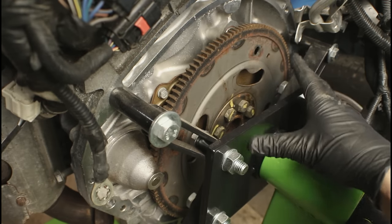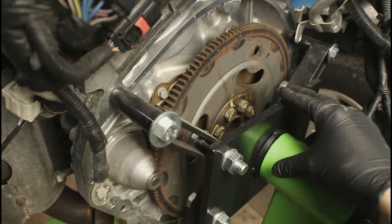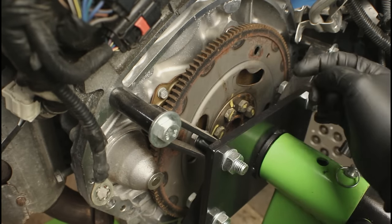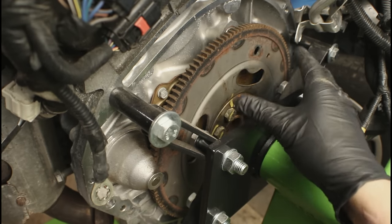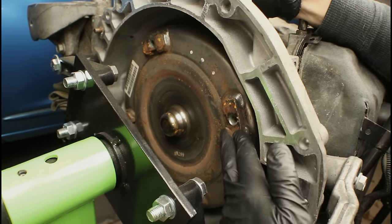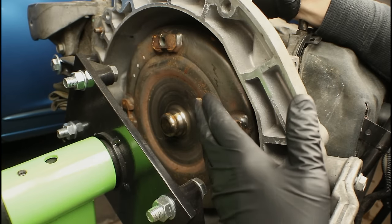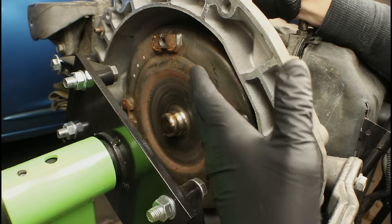When the engine's running, the crankshaft is spinning. The crankshaft is the heart of this engine — it controls piston movement and everything that's chain driven or belt operated. The crankshaft runs the whole length of the block and comes out the front and the rear. That's the rotating item on the block that we need to connect to the transaxle. It's the rotation of the crankshaft that turns the torque converter, which I'm pointing to right here. The torque converter turns the front pump, which controls all the hydraulic pressure inside the transmission, operates all the clutches, and gives you all the gears and your movement both forward and reverse.